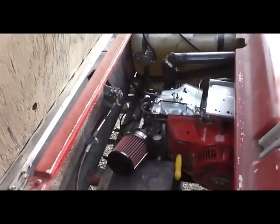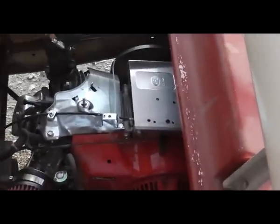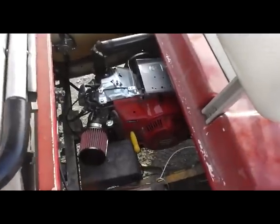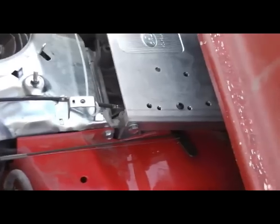New fuel pump, because the old one had that little diaphragm all clogged up with gummy stuff, so I went ahead and got a new one. The only drawback — it might be different with your golf cart if it isn't a Club Car — but about the first half pull of the throttle does not engage the carburetor until you press it a little more than half, and then it starts to move and you're good to go.